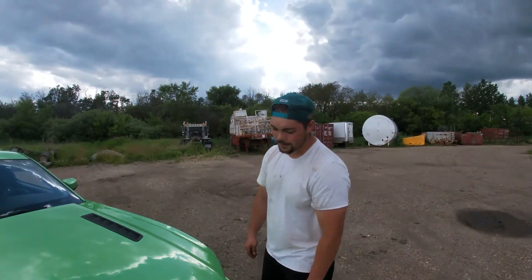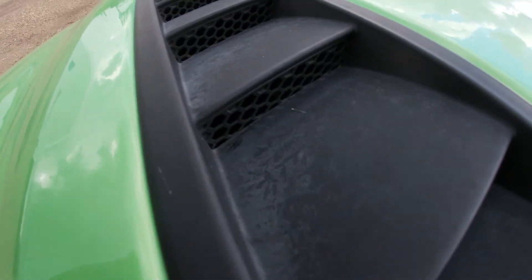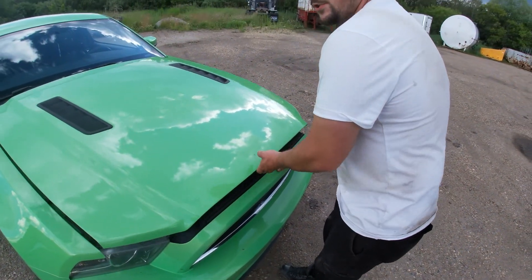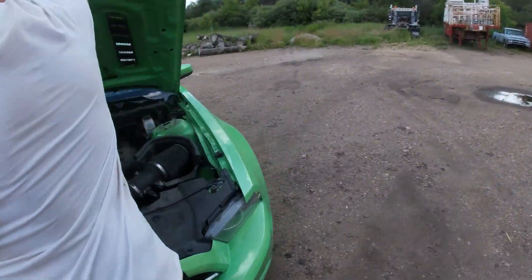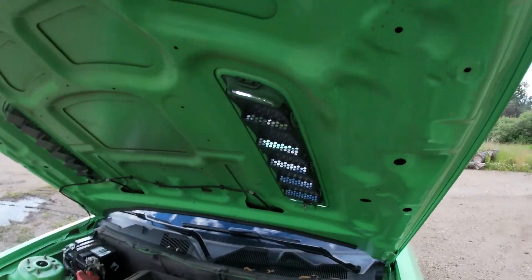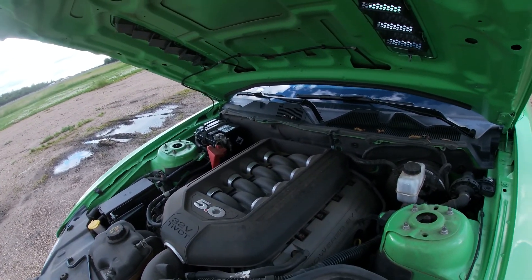No rain for this baby. Pop the hood — so yeah, these are real hood vents as you can see, and water can get into those. So if you're going to buy one of these and you're going to do a cold air intake, make sure you get a cover or just don't do it. Because hood vents feed straight into the intake — we've got that Roush intake — and water just gets in there. The big Coyote sucks it in and she runs like crap.